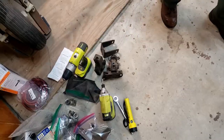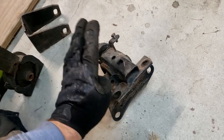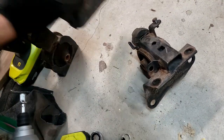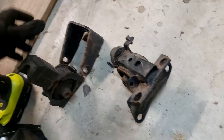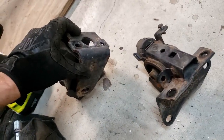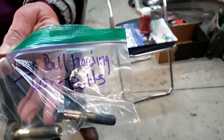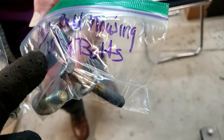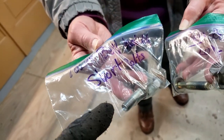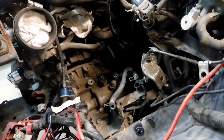Motor mounts are out. This one is the top motor mount over on the driver's side. This one is the front motor mount — this sits upside down like that on the casing, then this attaches and it all sits like that. I have also removed the rear bell housing long bolts and the lower bell housing short bolts, which I will not confuse — bag and tag. Then I've got the last two bolts left.